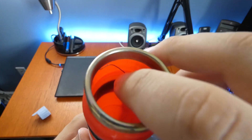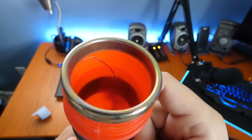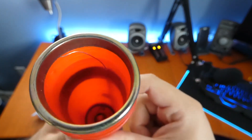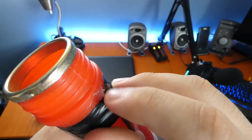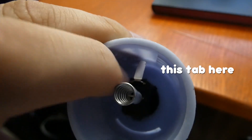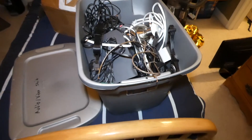Something wasn't making contact properly, so I decided to open the pump up. That's when I discovered this little tiny hair-thin wire that goes from the little ring at the top of the pump down to the motor. The reason it goes to this ring is basically because the switch, when you screw the cap onto it, makes contact with the ring and completes the circuit. Here's a diagram — I'll kind of show what I'm talking about. Anyway, this wire was broken and needed to be repaired.